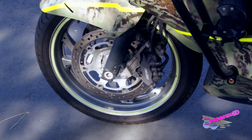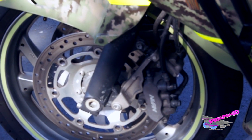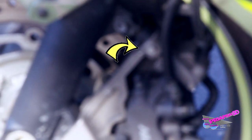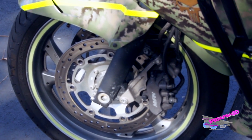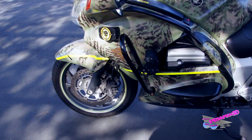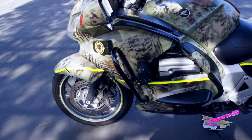This version does have the anti-lock brake system, but unfortunately it's also got a linked brake system. The ABS works pretty well for its original generation, but the linked brake system adds a lot of complexity. The rear brake is more important on this bike than the average sport bike since it's more of a rearward weight bias. The front caliper has actually got a small secondary master cylinder on top of the carrier mount. So when the front brake is activated and it rotates the carrier forward, it activates the master cylinder and puts pressure on the rear. The side effect is you end up with seven bleed nipples on this bike — meaning you've got to pull the entire bodywork off to get to all of them in the exact sequence the manual specifies. Makes it a real pain in the butt.